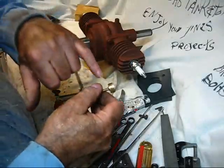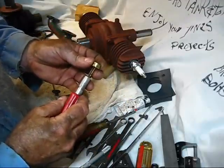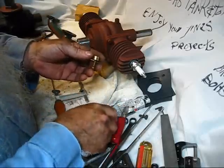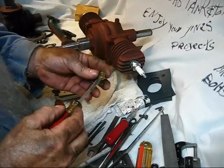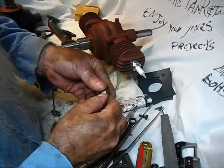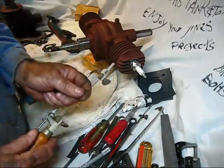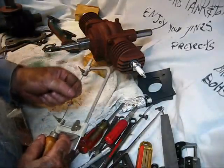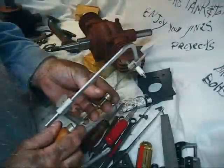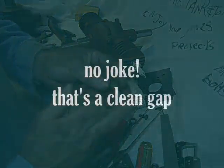The little drain-back for the crankcase is that small gap in the side of the carb. A lot of times you'll find somebody put a set screw right there and it can't drain back. If you clean that up with a regular hacksaw blade it's too wide — that gap needs to stay around 20 to 25 thousandths. Use a jeweler's saw with a really thin blade, just go in there and clean it up. Don't make it any deeper or any wider.